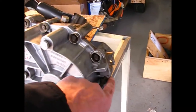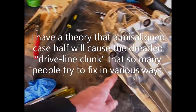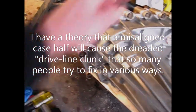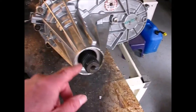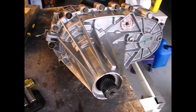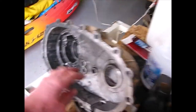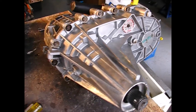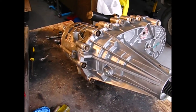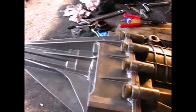When you put the shell back on, make sure you get the little dowel pins — it's a little dowel skirt that goes into two holes on here and keeps it straight. If it's not straight it will ruin the case — that's not a good thing. Take them off your old case half, put them on your new case half, put it together, and torque it down.